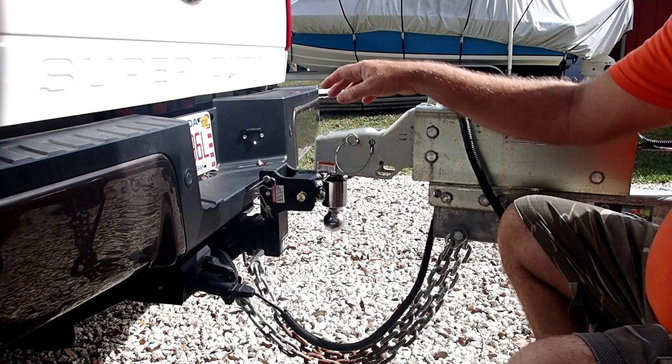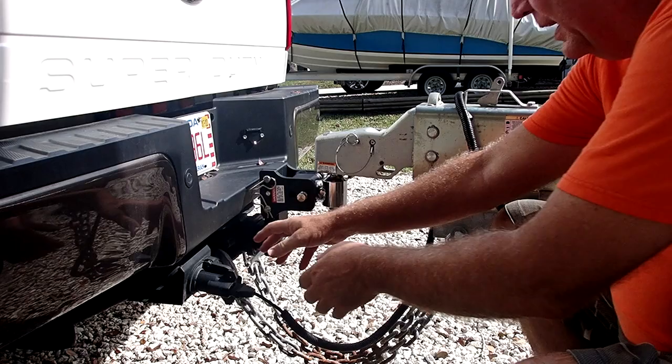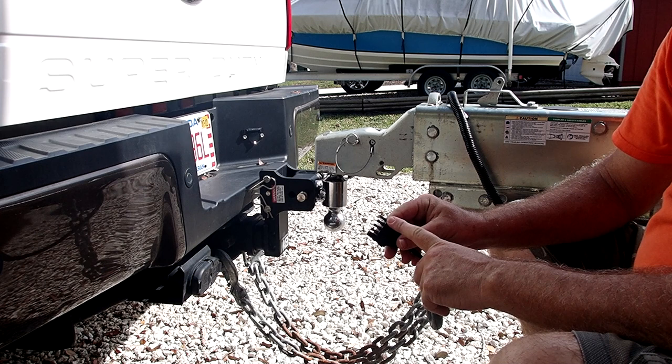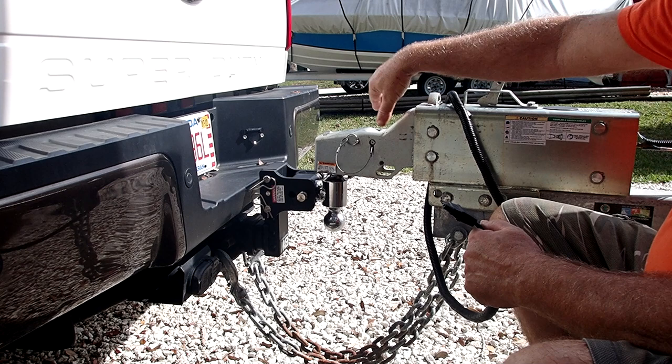What we're doing today is making an alternate way to lock out your trailer brakes for when you're trying to back up. The way the design is supposed to work is a lot of the newer ones have five pins instead of four. The fifth pin comes off your backup lights and energizes the solenoid to release your trailer brakes so that you can back up, because as you back up your tongue comes in and activates your brakes.